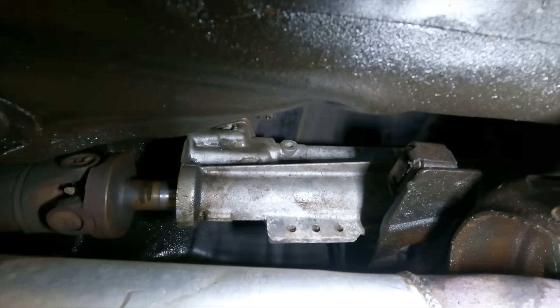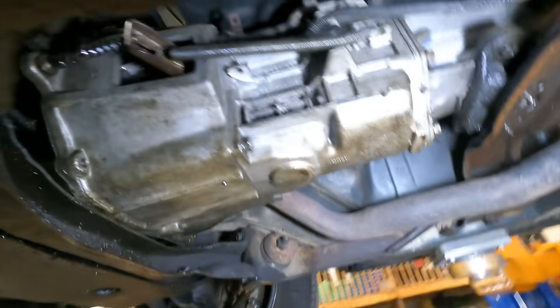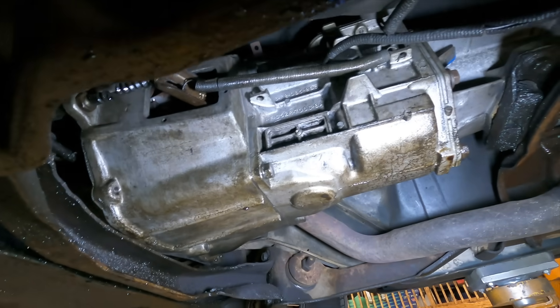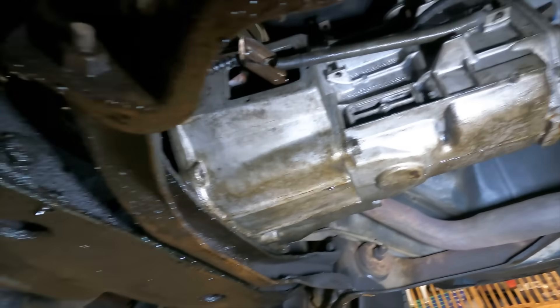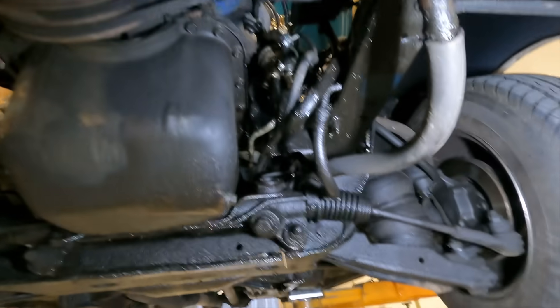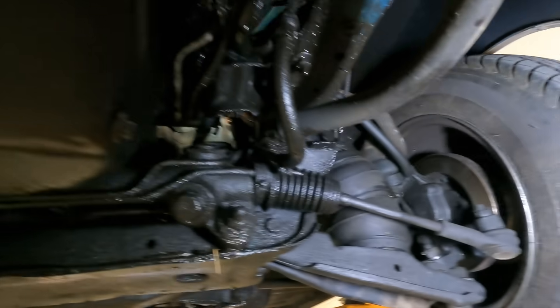I need to do a little bit of checking, but it should have a tail-shaft mounted shifter, slip yoke, all-aluminum case, the top is bumped up a little bit — which I think confirms this is the BorgWarner SR4. So I'm gonna pull the driveshaft out first, then try to unbolt the transmission, leave the bell housing and clutch in place, and pull the tranny out the back. We have some major oil leaks going on under here that I probably should take a look at.